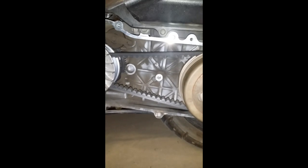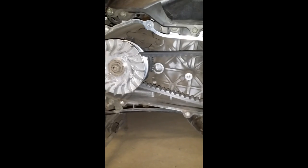I don't know if you guys can see very well, but that one there had been damaged previously by the previous mechanic that worked on it. Ordered up a wheel bearing, and I ordered some oil seals that go on each side of the bearing. It's more like an oil seal, dust seal. And so I'm going to change these out right now so I can get rid of this problem, because I really don't like what's going on.